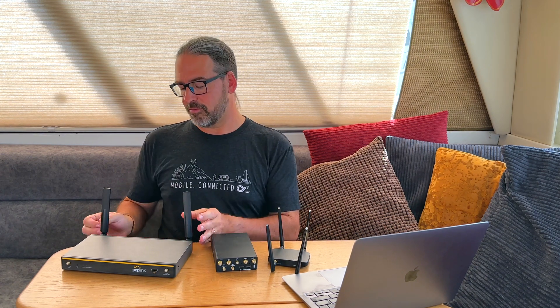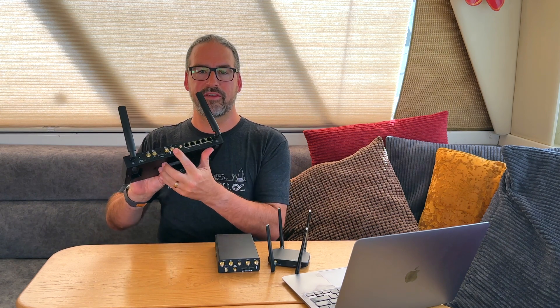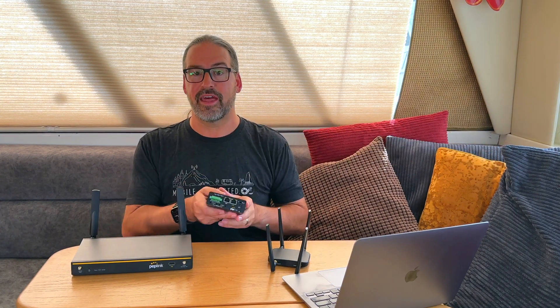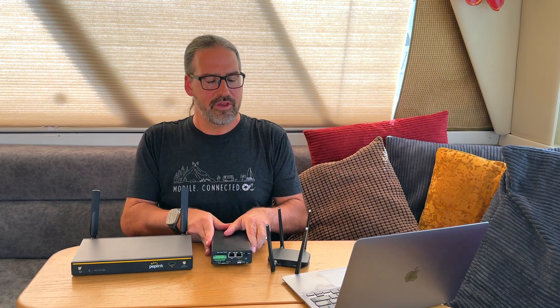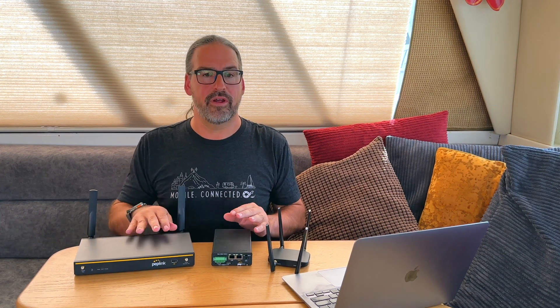There's one other new feature on 8.3 that brings more WAN options to devices that have paid up PrimeCare: the new virtual WAN port feature. If you've got a device with only a single WAN Ethernet port but lots of Ethernet ports, the virtual WAN feature will let you turn one of those into an additional WAN port. Or if you've got a router with just a WAN and a LAN — two Ethernet ports — you can make both of those WAN using one as a virtual WAN. You can even use a managed switch elsewhere on your network with VLAN technology to create a WAN port there.